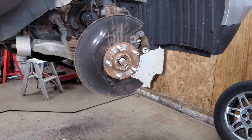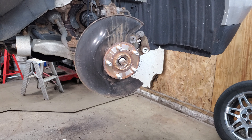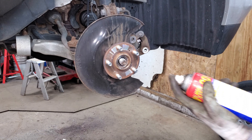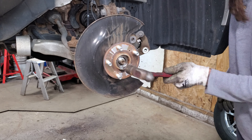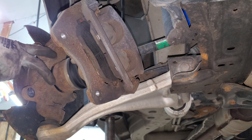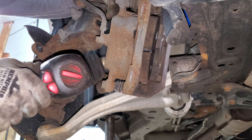I'm getting it. I just want to make sure this axle goes in - it's kind of sticky. I'm going to put a little lube in here. There it is, it's in all the way. Now I have four 17 millimeter bolts on this wheel bearing - I'm just going to get them off with an impact and a swivel socket hopefully.